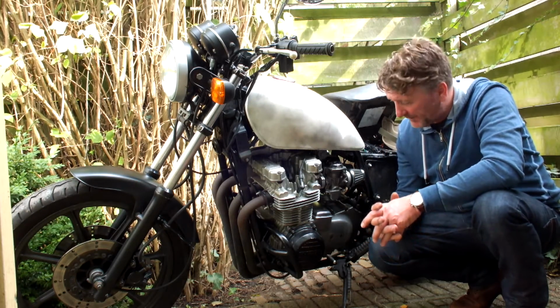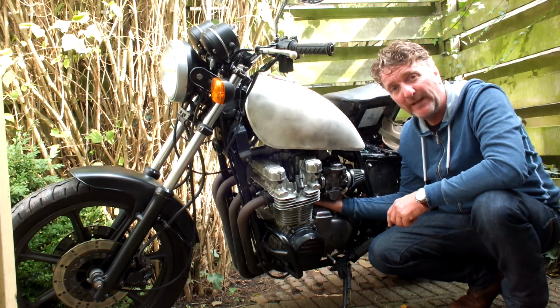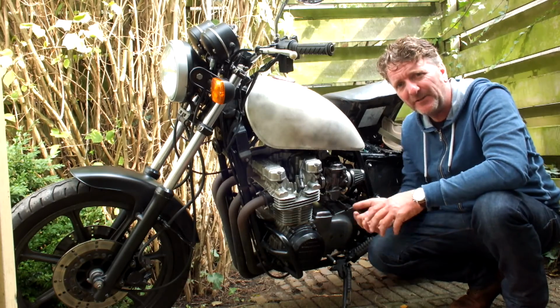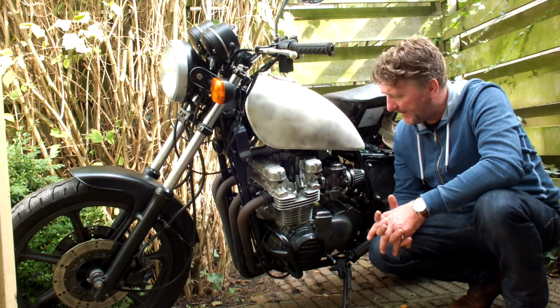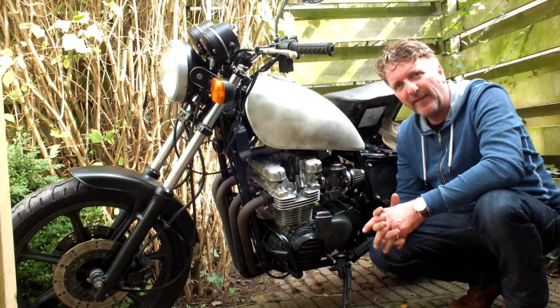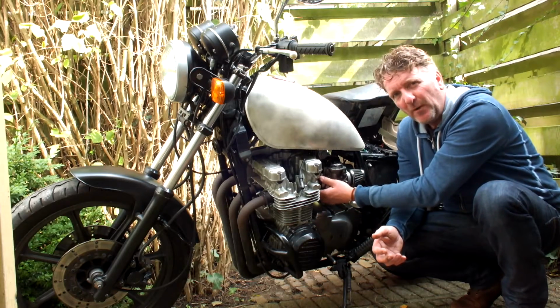What I also did was change out the cam chain tensioner. I bought one from Krieger, and I took out the automatic chain tensioner, which is already in this bike. I'm still fine-tuning the adjustment, so I'm still working on that also. With regards to the carbs, I'm going to need new carb boots.